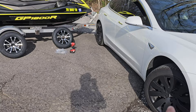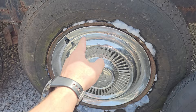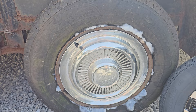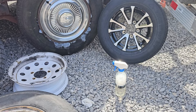I actually had to back up a little bit just to get it that close. What is going on with my trailer tire right there? What is all this foam? I sprayed some soapy water to find a leak — had a flat tire. These tires are like brand new, still got the nubbies on them and they're only about a year old. So why is it leaking? Well, right on over this bead is where it seals to the rim, and that rim is all corroded. You can see the outside's all rusty — the inside is the same way. This tire is another example: you can see the sidewall has some deep cracks, and you can see the belts splitting across even though the tread looks good. This is a flat tire waiting to happen. You're going to be on the side of the road with cars passing at 70 miles per hour. That's a safety issue.